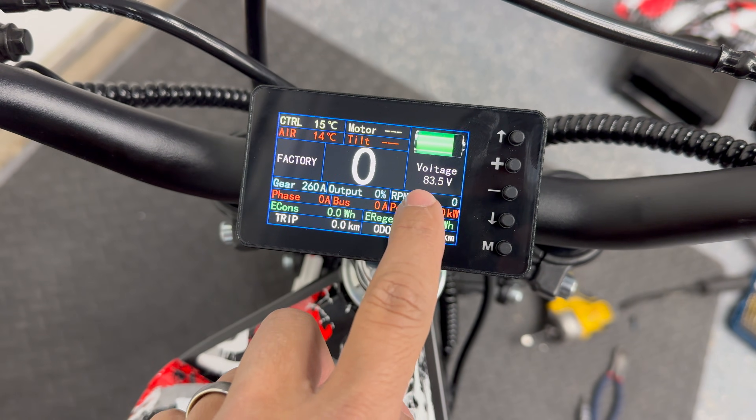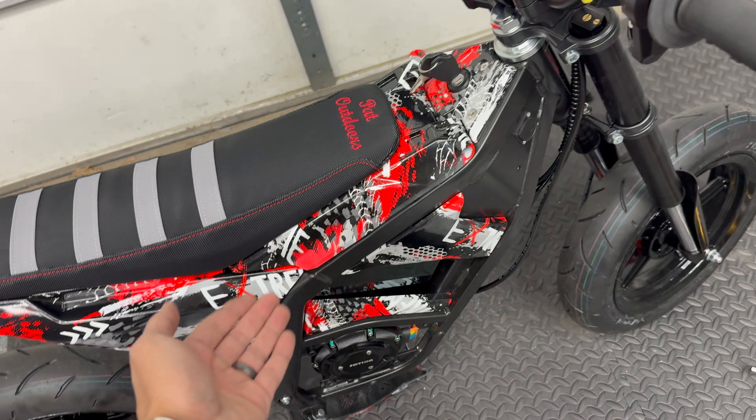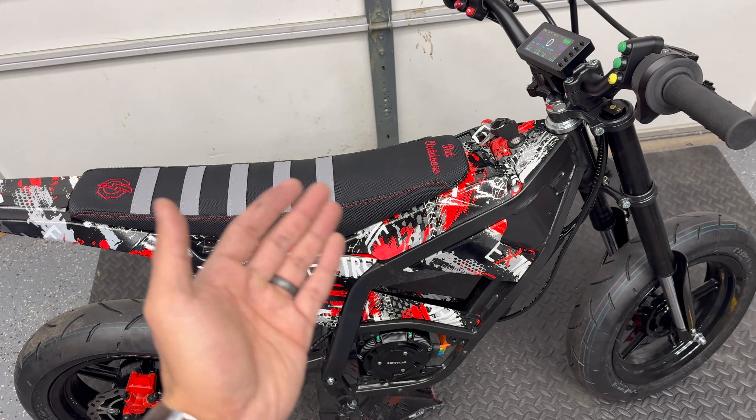We got it — 83.6 volts, which is fully charged for the Emerge battery. We can't ride it just yet; we need to program the controller to work with the Sosian motor and set the battery limitations. I might hit up Billy from Electric RVA for tips on properly setting it up before we take the bike out for the first time. This is the most basic way to get the Moxing controller installed and functional, but there's still more to do — properly secure the bottom, trim the plastics, and clean up wiring above the battery. Stay tuned for the next video for the tuning and setup process.